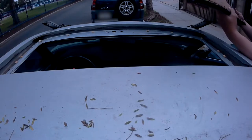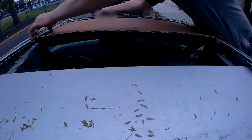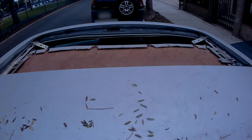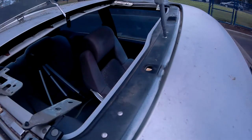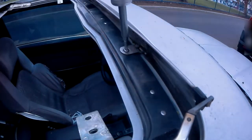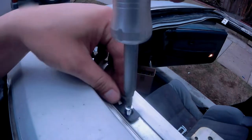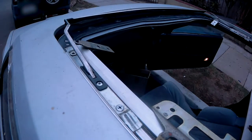But before the rail goes in, you should slide this panel onto the rail. Now the rail can be reinserted. Since this panel will be getting in the way, just push it all the way back. These Phillips screws can now be reinstalled — start with the two in the middle. Now the deflector can be placed into position and screwed down. Follow that up by installing this screw at the corner, then reinsert this bracket here. To reinsert the deflector's arm, insert the front piece in first, then press it down and screw it down. Now go ahead and reinstall the last screw on the driver side. To ensure both brackets start at the same location, move this all the way up against this metal bracket, and do the same for the other side to ensure both sides are even.